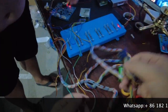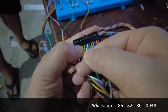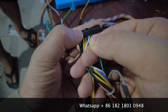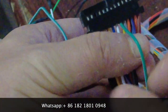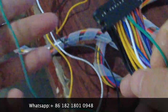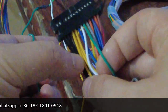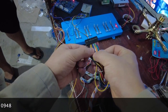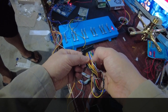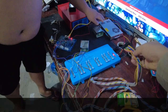Also, we need to be sure about the other cable — number eight of this connector on this harness must be the SSR cable. This cable must be on position eight of this connector. So to summarize: the black cables are for ground, the yellow cables are for 12 volts, and the green cable is for SSR. Then connect it to one of the PlayStation ends.